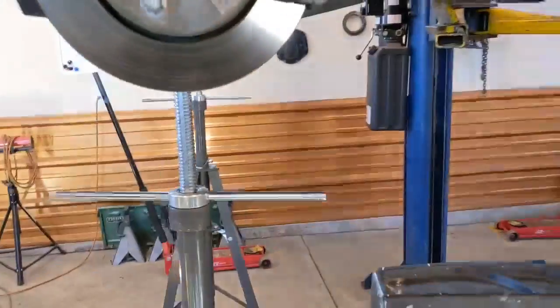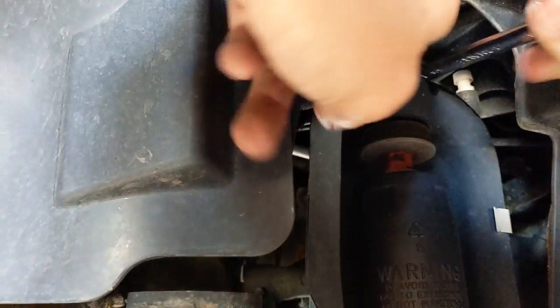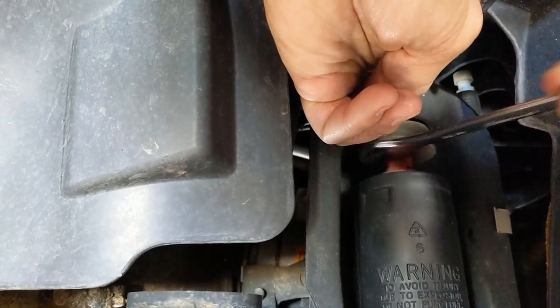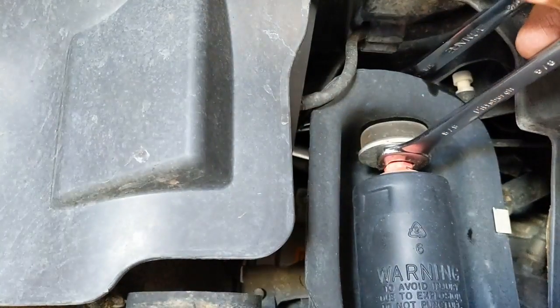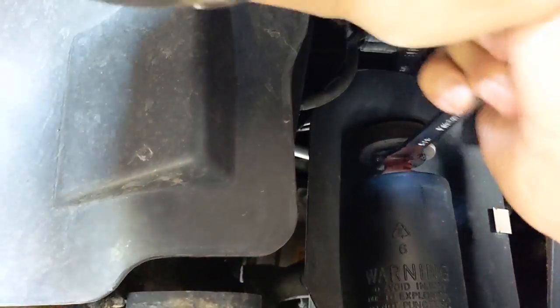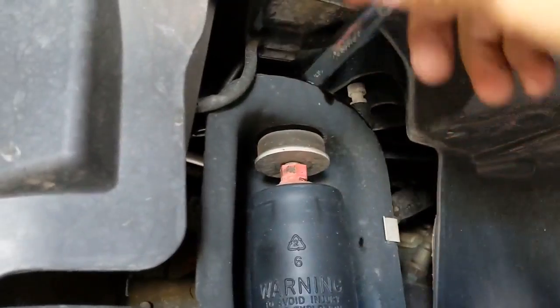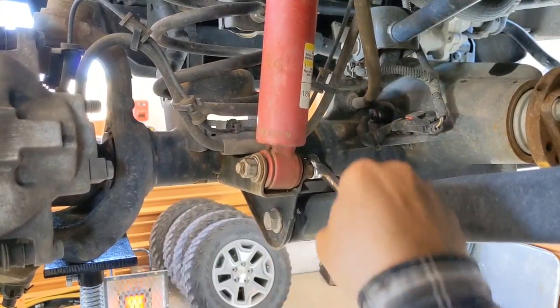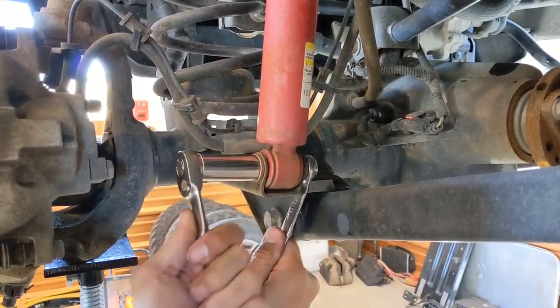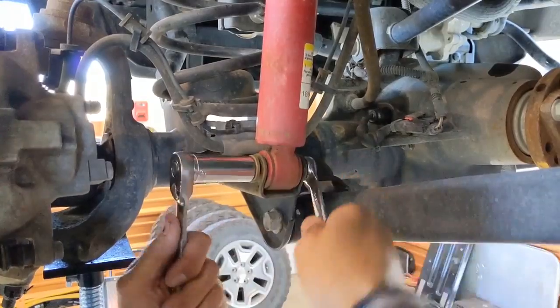This will be my first rust issue. If you look up top, you'll see the shock stem has rust all over it. I'm going to take some PB Blaster, let that sit for a bit, then come back and get it — I'll do the same thing to the other side. You have your stem nut up top and you need to back it with a wrench. With the upper stems off, come down and get the lowers — you'll have to back those too or they'll spin. This might be another good spot for some PB Blaster.